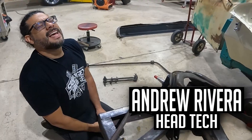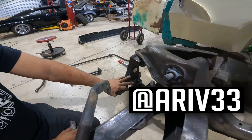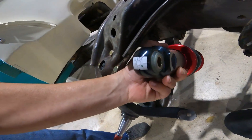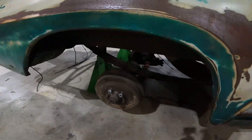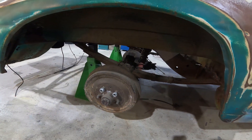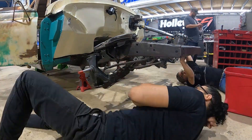We're going to be using a C10 knuckle on the front of the Harvester, mock it up, see what clearancing we have to do, then make some lower mounts and invert them, creating a pocket inside the upper control arm. First we'll tear apart the front end. We're also changing out the rear end because this dinky rear end won't hold up to our LS — upgrading to a four-link with Builder Series shocks back there too. But first, let's get the front end mocked up.